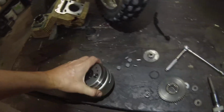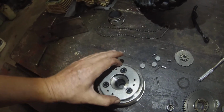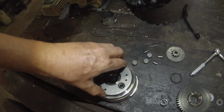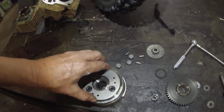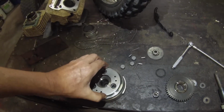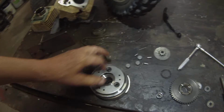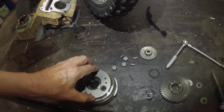And then the first thing I noticed when I had a look at the back here, there's got to be a problem here. First thing I noticed, it's loose. Ta-da! There's the problem. That rattling was doing this. When the crankshaft was slowing down, it'd get that rattle in it. And that's a rattle that people have said they've put up with for several years on these engines. And I don't doubt that was it. It would just rattle and drive you mad. So that's the problem. I'll have to undo this, see how it all works, use Loctite and things and make sure it doesn't happen again. But it's all to do with the starter motor.